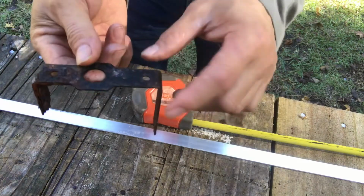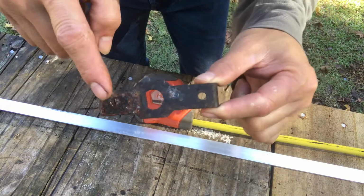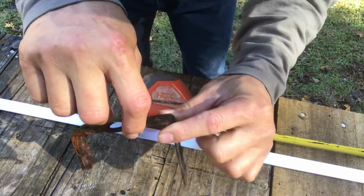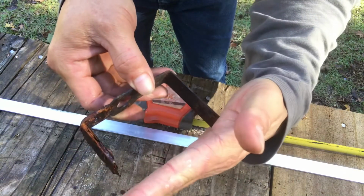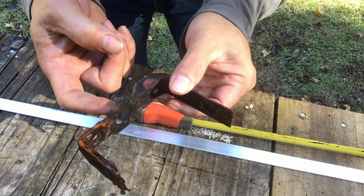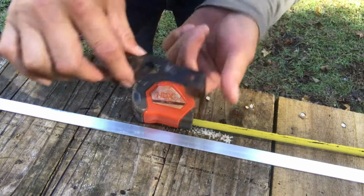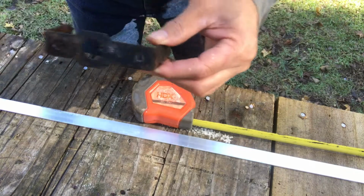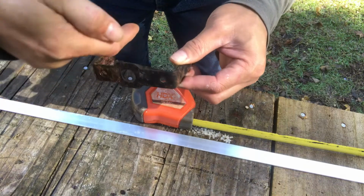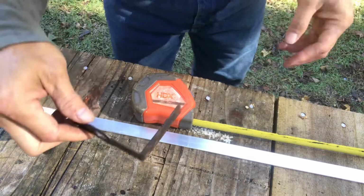Here is how the back of the bracket looks. It has this hole, and this hole goes onto the boat to hold the bracket and attach it to the panel to hold the meter. And this hole is for the hose that comes up from the engine and measures the speed of the boat. The water goes into that hole with pressure, goes into the meter, and pushes the needle up and tells you how fast the boat goes.